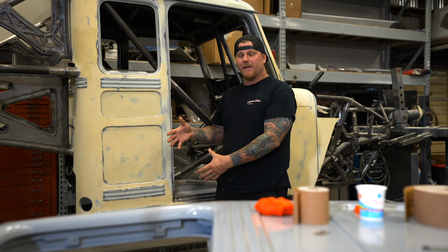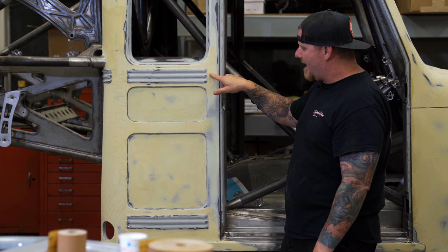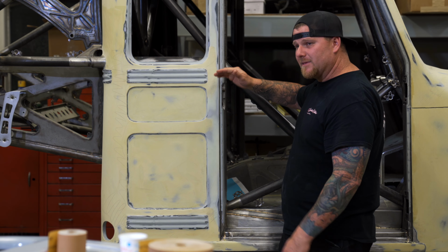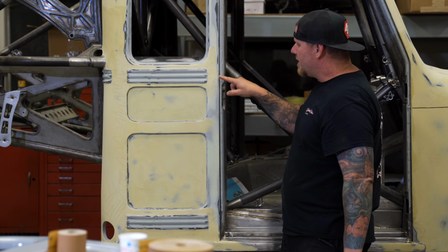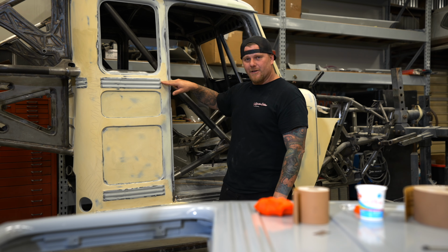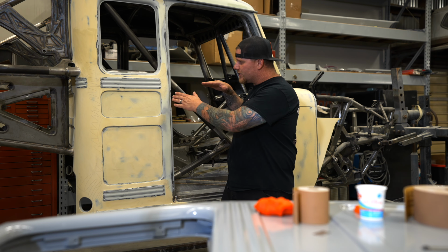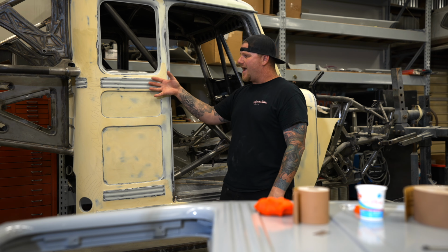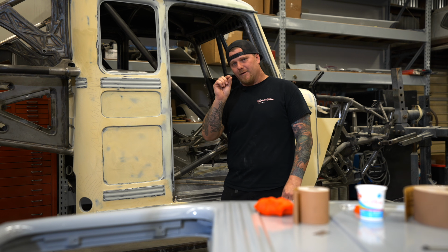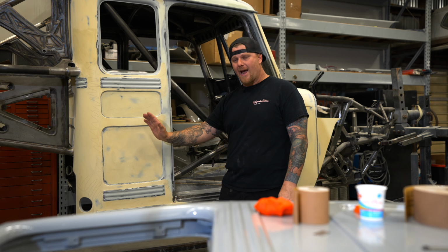The goal is that you're putting a minimal amount of filler on something, because when you have these issues, if you have excessive filler and maybe this weld seam didn't get just perfect, you end up with this ridge where this sinks down. If it sinks down ever so slightly here, how are you going to bodywork that and look smooth without losing this? Everything in this bead needs to be brought up ever so slightly, just like we're doing out here on the extra cab portion of this cab.